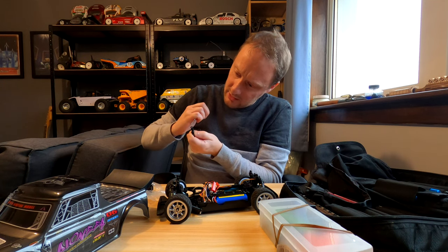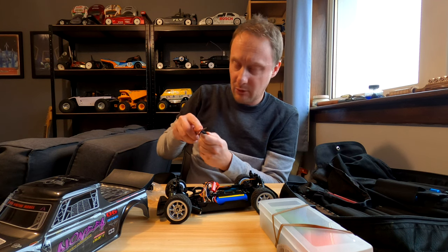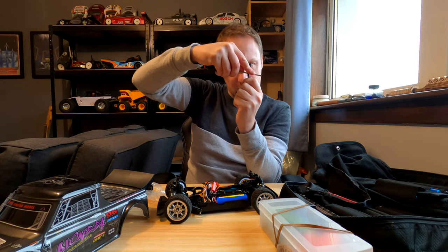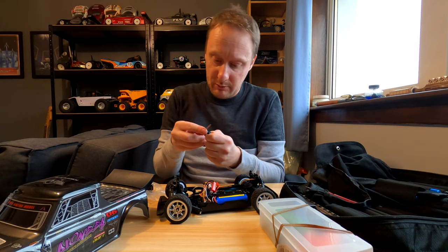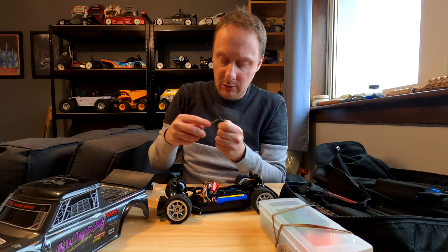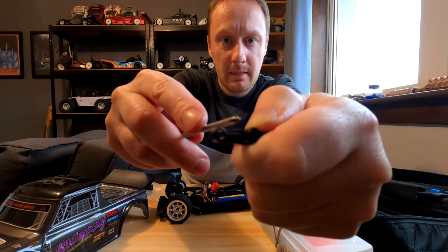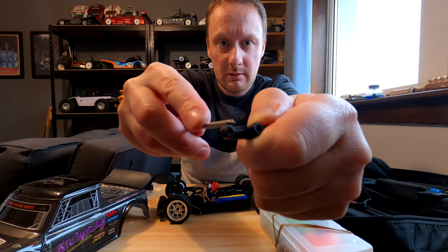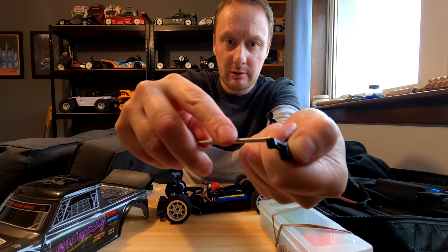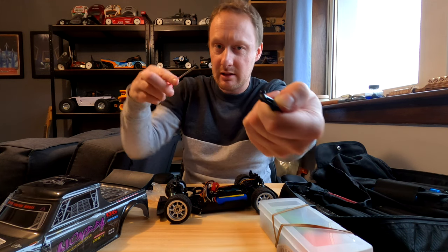But I don't think they are cracked through. I don't even know if they're surface cracks. They're like really bad looking mold lines. And the way the light was catching it, I could have sworn when I was looking at it before that it looked like they were opening and shutting. I think it was just the way the light was glancing off the mold line. It's raised. Listen. You hear that? My screwdriver's hitting the raised mold line. Same at the top. This is the one that looks worse. So it's raised up. So it isn't a hairline crack.